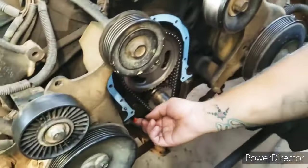The threader. I'm gonna have to grab it with like a crescent wrench and do a little at a time. Got a new bolt in, nice hardened one. So that actually worked out really perfect. The gap's closed up. That's just oil I used for lubing the bit. Let's see, now I'll go get a puller or a power steering pump install kit and push that in the rest of the way. And that should take care of the belt walking off the pulley down here.